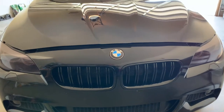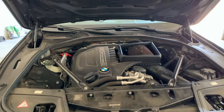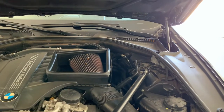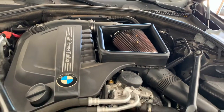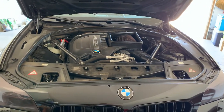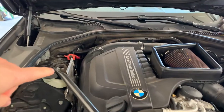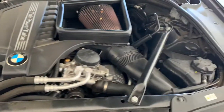It's another day - let's finish what we started. It didn't quite work out the way I intended, simply because I couldn't jack the engine up high enough. You either lower the subframe, but then you have to hold the engine and the subframe while lowering - I'm just not equipped for that. The only other option is to make space towards the top side, which means removing the bracket that connects the engine mount to the engine. On the passenger side that's somewhat easy, you have access from the bottom. However, on the driver side, it's a little different.